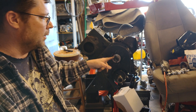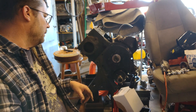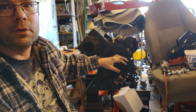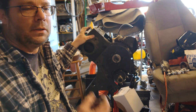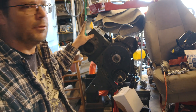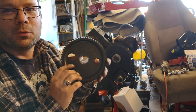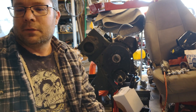There's a spacer in here that you need to make sure you keep in the right spot, and these four pieces I think help hold the front plate on — I'm going to have to dig into that a little bit more. I'm going to try to do another video on taking the exhaust valves out. They gave us some trouble the other day where they're not compressing enough to let the keepers come out, so hopefully I can get a camera angle to show you that. I'm going to close this video out now that we've got the cam gear off. Sorry Rich, you weren't here to do that, but there's plenty more work to be done. I'll talk to you guys later.